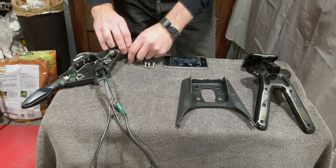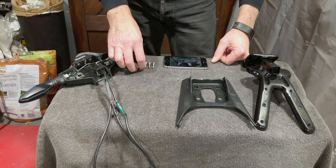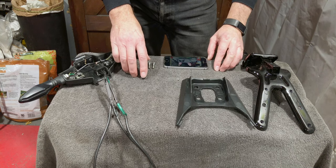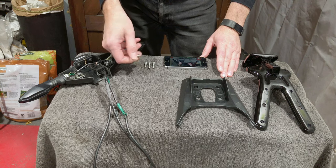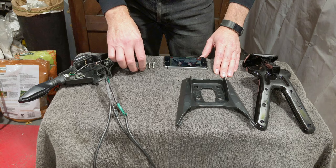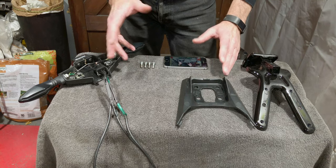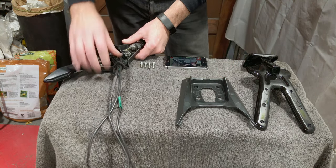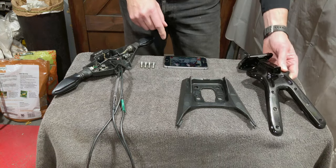What a surprise. This is why I do stress it is worth spending a bit of time making stuff to a high standard. If you do buy a cheap tail tidy like that, use some decent bolts in it. It's quite easy to get hold of A2 or A4 grade stainless steel marine grade bolts that won't rust very easily. And not some cheap steel rubbish. So what we need to do is get this all clipped in and onto here. So let's get on with that.